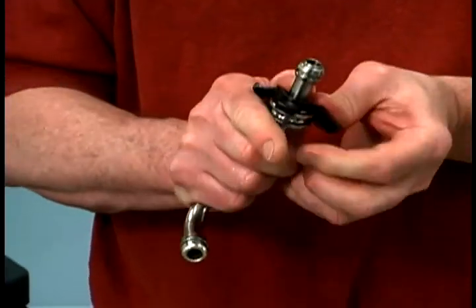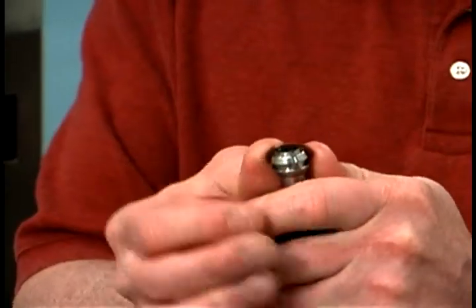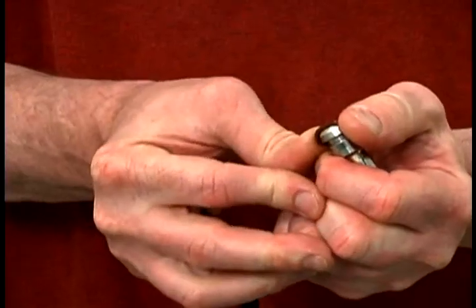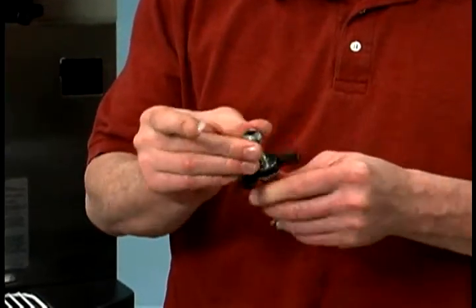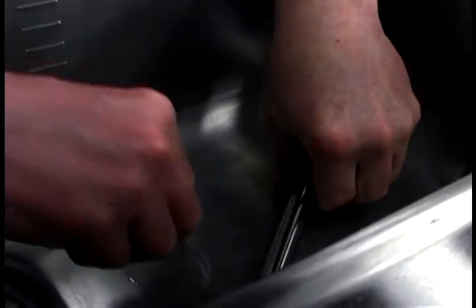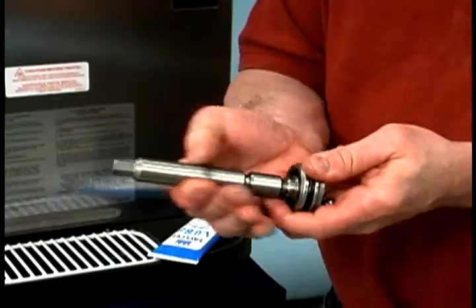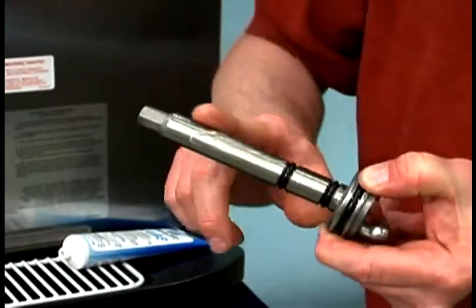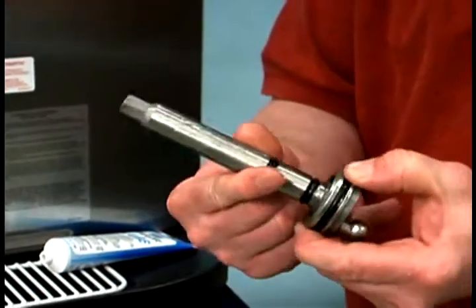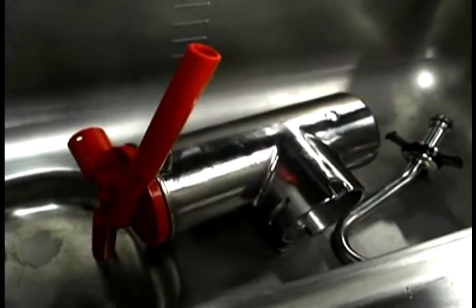To assemble the feed tube assembly, slide the valve O-ring into the groove of the feed tube. Install the two red O-rings on each end of the mix feed tube and generously apply lubricant. For the C707, place the feed tube and orifice into the bottom of the hopper. For the C706, slide the large black O-ring and the two smaller black O-rings into the grooves on the shaft and thoroughly lubricate the O-rings and the shaft. Do not lubricate the hex end of the shaft. Place the pump assembly, the pump clip, the mix feed tube, and the cotter pin in the bottom of the mix hopper for sanitizing.